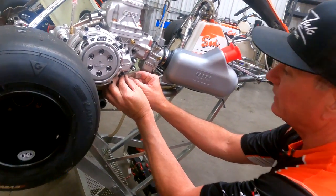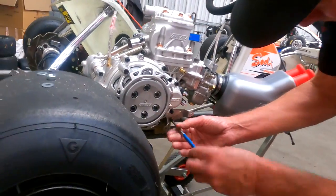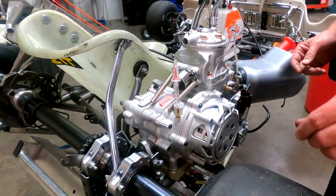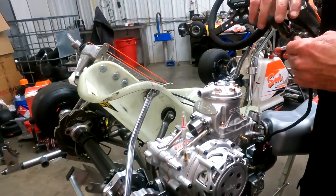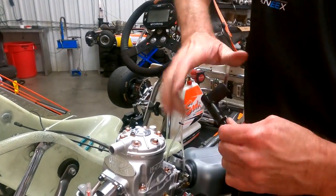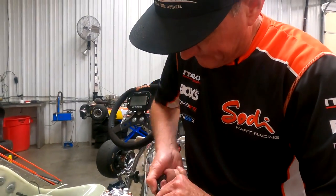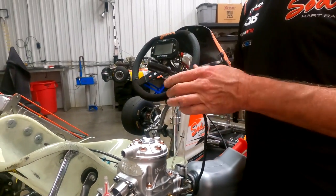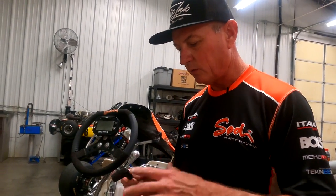This is the bracket for the fuel pump. They put on the spark plug boot and it just kind of threads on — push it in while you're pushing the boot on to make contact inside the boot. If we ever have ignition problems, that's one of the first things to check. After a few months of use, if you're getting any intermittent problem in the ignition, just go in and clip the very tip of that coil wire and rethread it back on.